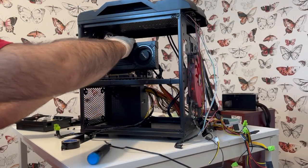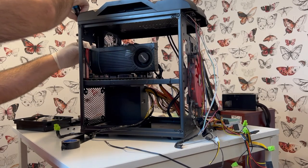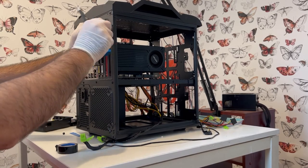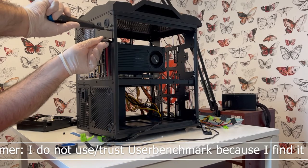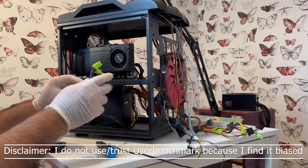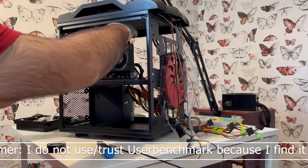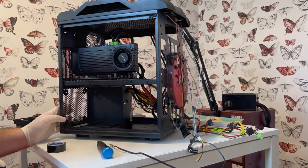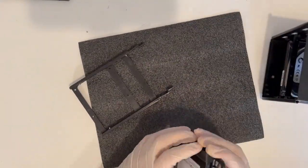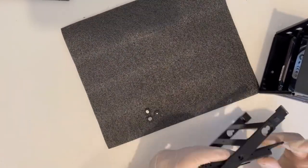Next, the GPU goes in, and this time I again reach for a GTX 970. I am a bit bummed it's a blower-style card, but at this price point spending an extra 10 to 20 pounds on a dual-fan model is very difficult to justify. I know this will provide adequate performance especially for the price, and for the first time — and probably last — on this channel I feel the need to quote the UserBenchmark score, which lists the GTX 970 as being 1398% faster than the GT710. Just in case I haven't mentioned it enough, this PC is targeting the exact same price point. I opted to include a 500GB hard drive — I give these out as freebies in my builds, as drops during shipping and hard drives don't mix well. Free is free at the end of the day, and until now all but one have survived undamaged.